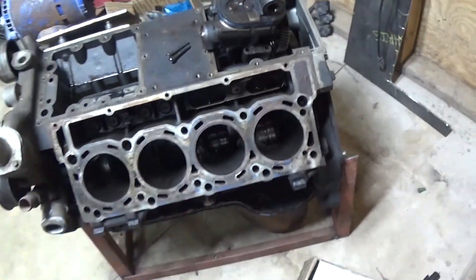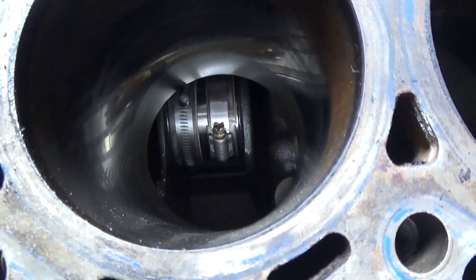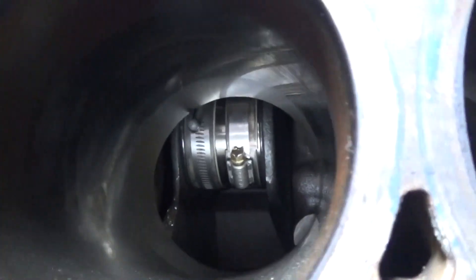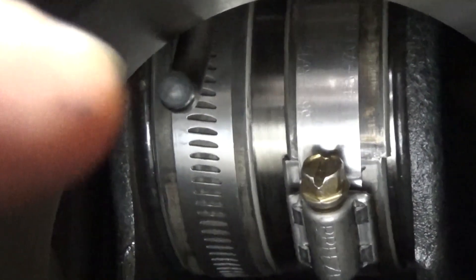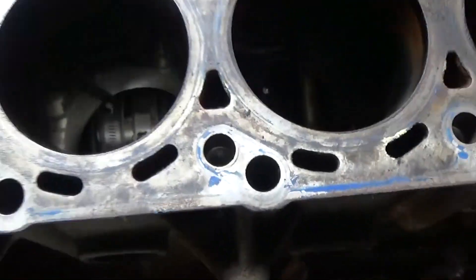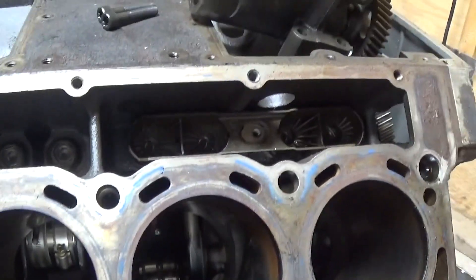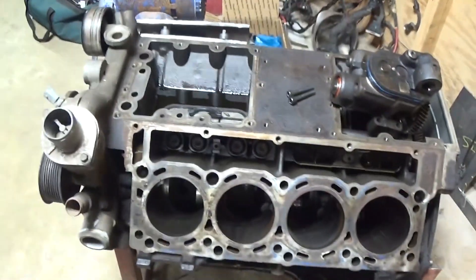You can see I've got the pistons out of it, but I have hose clamps on there holding the rod bearings on. Right there — that's the tip of the piston cooling jet — I've welded all of those shut. You can see that one there too, so they don't spray up. I've left the lifters in; I need to get my other holder so they don't come jumping out. That way they hold oil pressure.